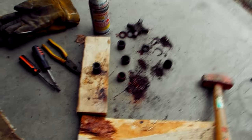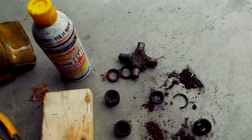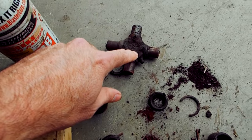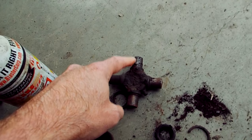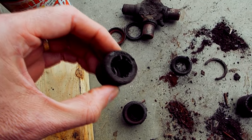It hadn't been greased in years by the looks of it. When I tried to grease it by removing the end caps that hold the drive shaft onto the yoke and started putting some grease in the fitting — you couldn't get to it with the drive shaft on — some of the grease came out the end here and it popped this cap right off, and most of the roller bearings fell out.